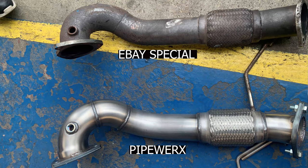Basically, by increasing the size of the intake or the exhaust downpipe, which is the bit that bolts straight to the turbo, I'll flag some pictures up now so you can see what it looks like, and that basically helps increase the performance. So tips wise, we've already covered it in some videos, but a bigger tip like a Badger 5, SFS, etc., an oversized tip, gets the maximum airflow. It's proven gains on the dyno, so that is guaranteed information. It's not just a case of I've heard it is great. Obviously I put it on one of mine as well, and it made a massive difference.